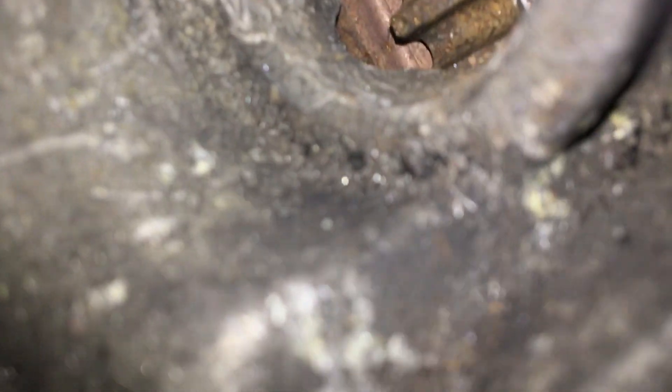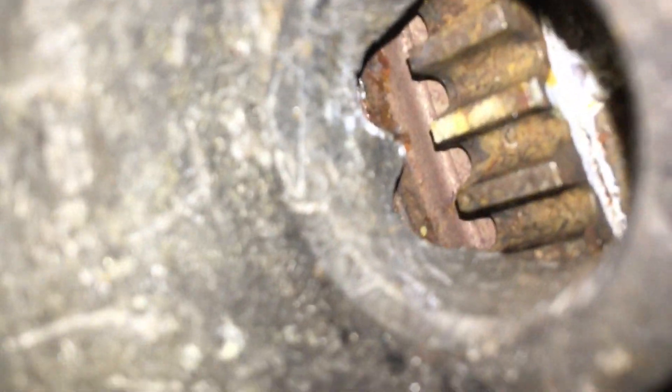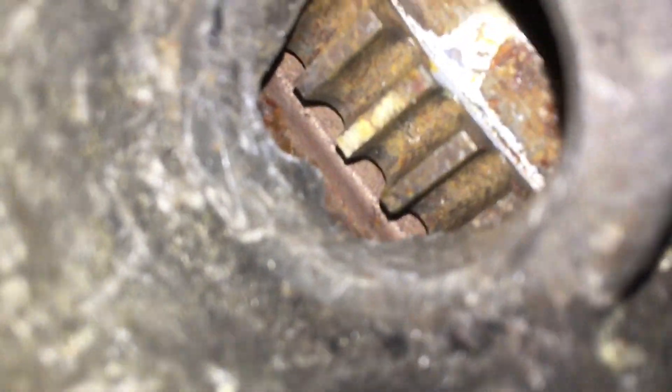The first thing we're going to need to do is set TDC. There's a little inspection hole at the top of your gearbox — there's usually a grommet in there — and you can see down onto the flywheel. Right next to that tipex-style cog on the flywheel you can see the groove, the indentation. You just want to line those two up. This part of the video isn't voiceover; the camera was too far away so I didn't want to be shouting.